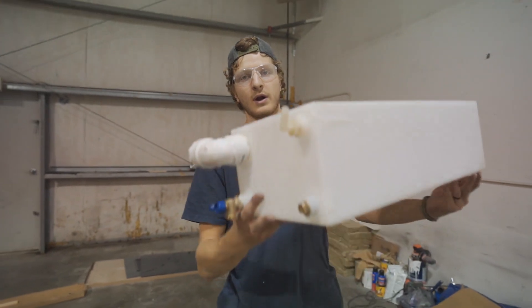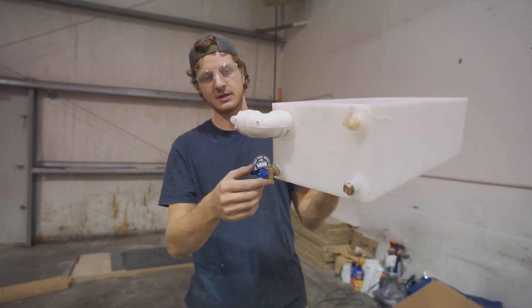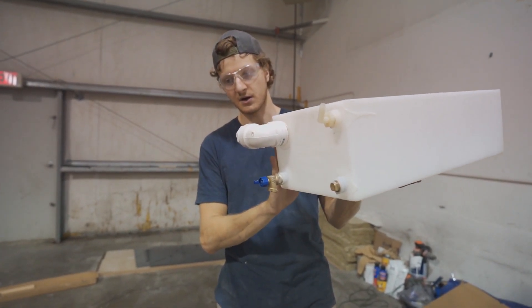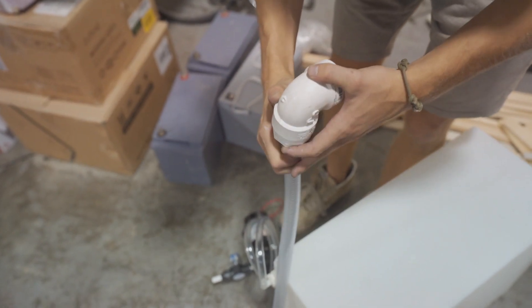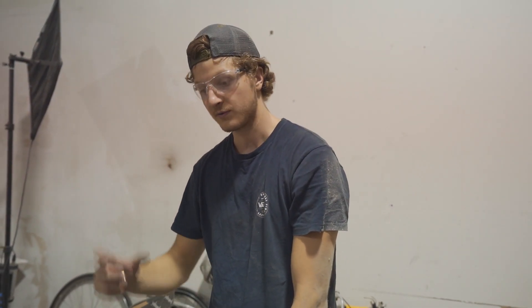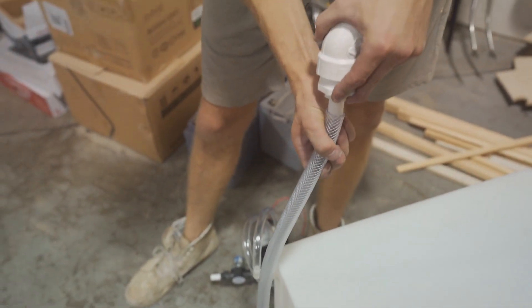It's important to recognize where everything goes — you want to get your inlet as high on the tank as possible so that there's no pressure on the water going in, and you want to get your outlet obviously as low as possible. On the Promaster, since it leans slightly forward and just where we're going to mount it, it actually does lean a little bit forward, so that's beneficial. For the fresh water tank — this is the fill port right here. The fill port will come down into this sideways tube and fill into the tank. Similar type deal with the 90-degree PVC. Your fill line should be pretty large, because if you filter from a large fill port down to a smaller line into your tank, it's going to get backwashed and you're going to have to spend a long time holding a heavy bucket of water on occasion.